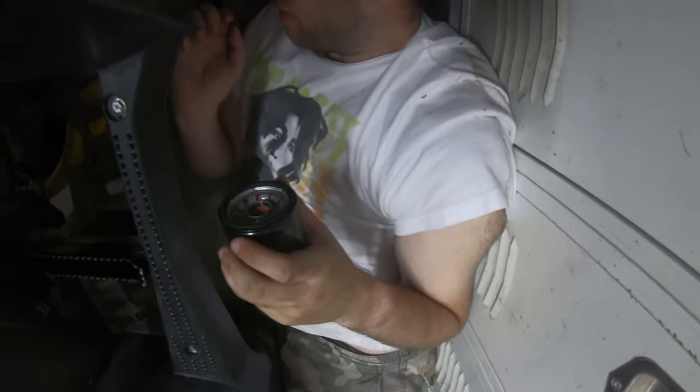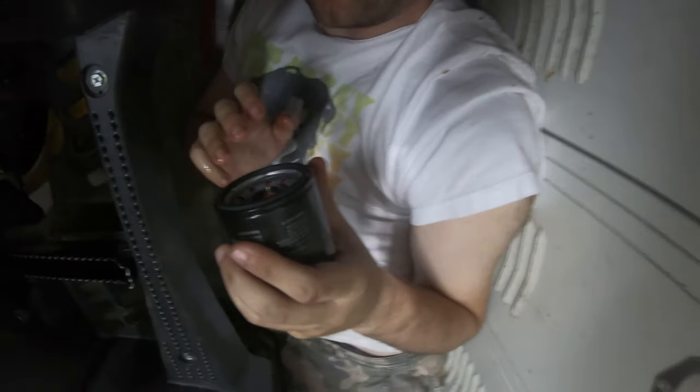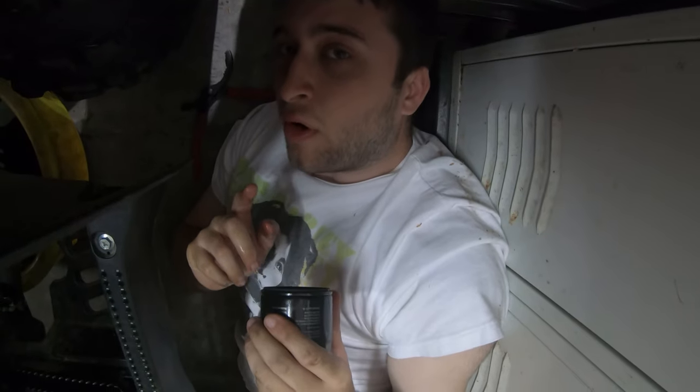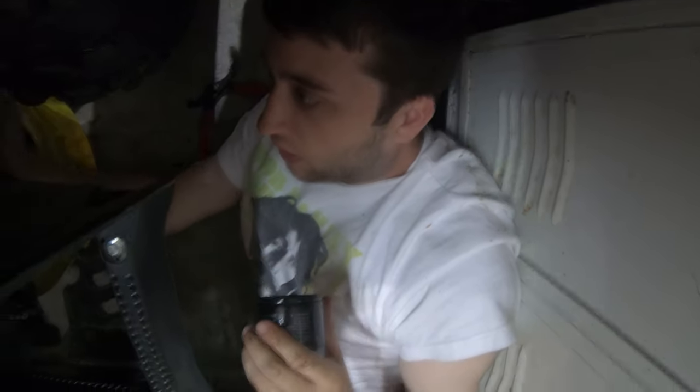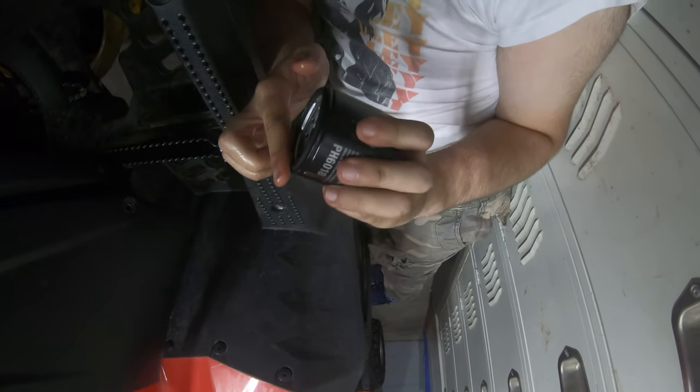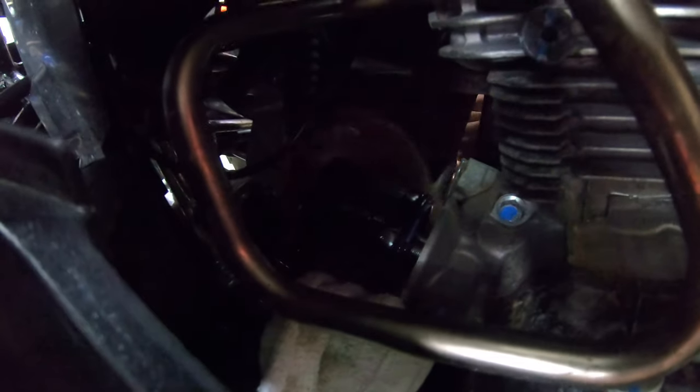I have oil on my hands because I just took the old filter off and it was very difficult to get off. The correct position to take it off is in the right side of the machine footwell right here. If you just notch this flat back right here, you can actually see the oil filter. Right here in the back is where you put the oil filter on. We're going to put oil on this gasket so the gasket slides on and gets a correct seal, and you just want this hand tightened.